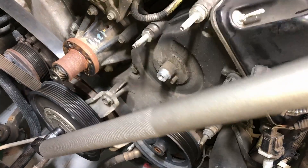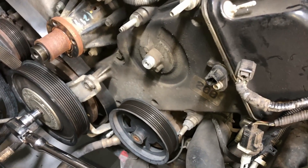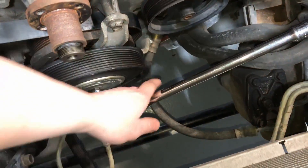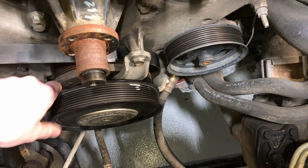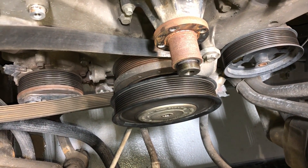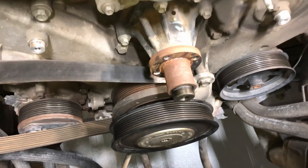You can see it down below turning off of there. Once you break torque on it, you can simply unscrew it by hand. Remove the nut here, and the double nut over here, then the bracket and pulley will come off together. That's how you break torque and get it off without damaging it — it's a three to four hundred dollar pulley. Hope this helped, see you guys next time.